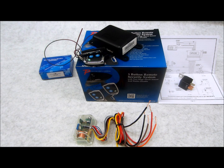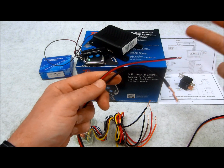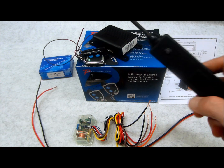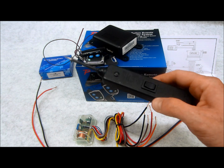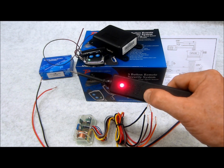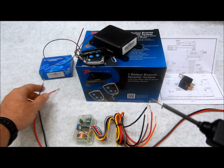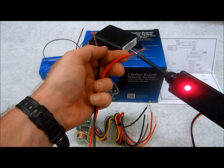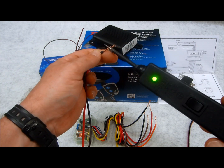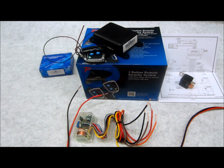Let me explain how my test display area works. I have a pair of wires — red signifies 12 volts positive, black is ground. Over here is my test light, which is connected to my power supply. If you hold it down it throws ground; if you push it up it throws positive voltage. When I test it to a wire, it just lights up accordingly. Let me show you how this wiring works on the 528T.